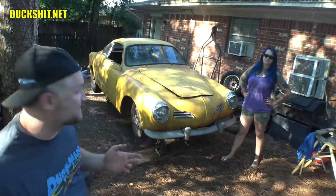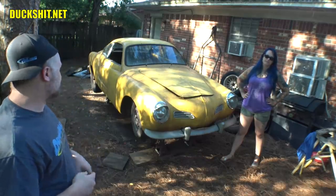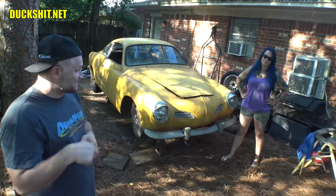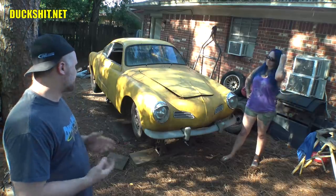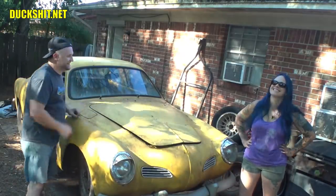The great thing about it is it is adjustable. You can go anywhere from stock ride height, maybe even a little bit higher depending on how the adjusters are put in, to dumping it all the way to sitting in the weeds. We can also put air shocks on the front of it — using your compressor, you can bring it right back up. All I have to do is take the adjuster screws out, install a set of shocks, and we can put them in about an hour. I can put the valve up in the gas door and put the air in right here. This is what I did on Ruby, the Type 3 Fastback, just the same.